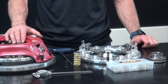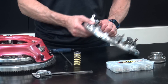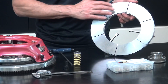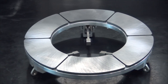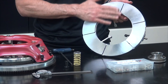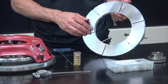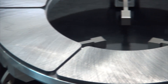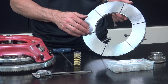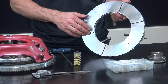Before we wrap things up, we're going to take a closer look at this aluminum billet pressure ring, which is really the heart of the unit. This pressure ring is machined from 7075 billet aluminum and has six individual steel segments on the face, attached with 12-point cap screws through the front and then surface ground to make your mating surface. The individual segments perform much better than a full circular ring, as aluminum and steel expand and contract at different rates — the segmented design allows the pressure ring to move around a little bit without warping or distorting that surface.